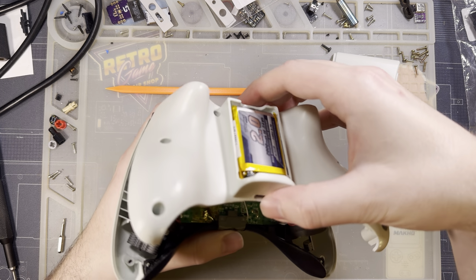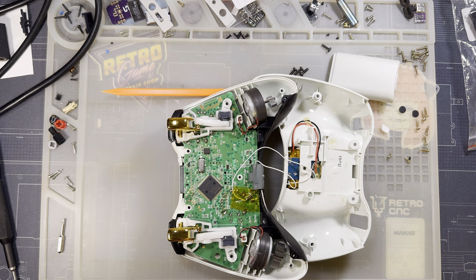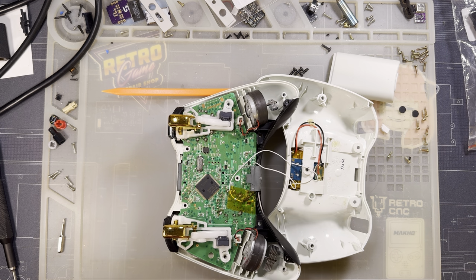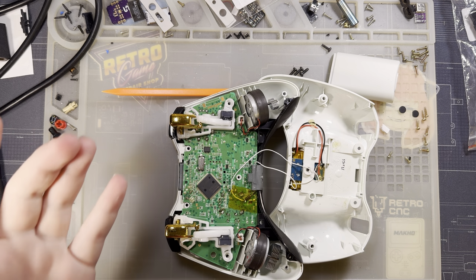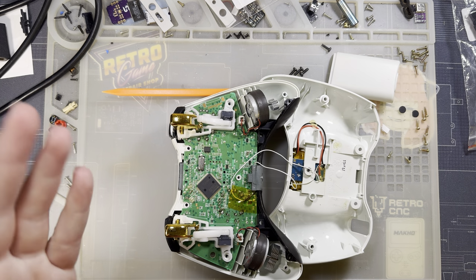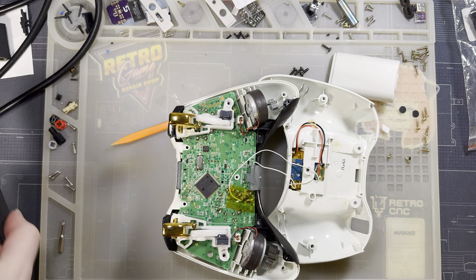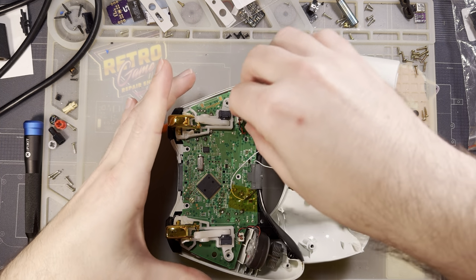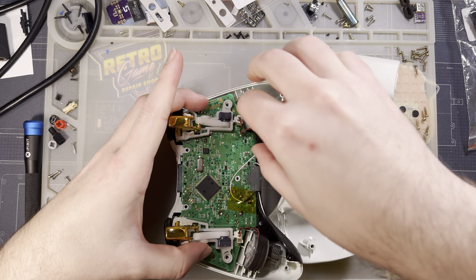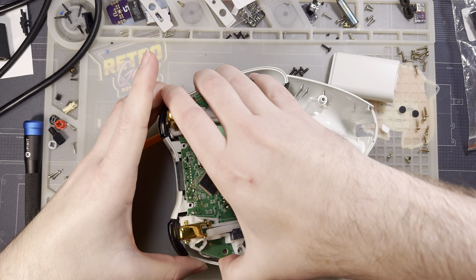This specific controller, I think I have had since like 2006. Internally, it's all stock. There's just a diode going from the output of the TP4056 into the input of the battery connector. Had I known at the time what I know now, I probably would have put a little bit more effort into using the controller's built-in battery management circuits, but I was young and ignorant and didn't realize that was a thing. These controllers have built-in nickel metal hydride battery management circuitry.